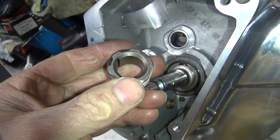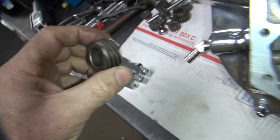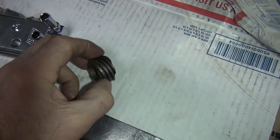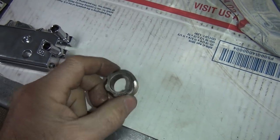Make sure that you have the big beveled edge going against the edge down there — that looks good. Next thing: make sure you've got six teeth. You can try counting them from the face or just go to the side and count them — one, two, three, four, five, six. Six is a light one. We're good.